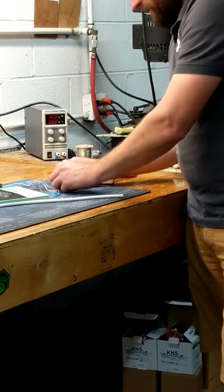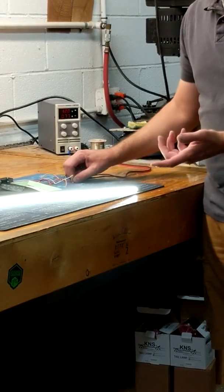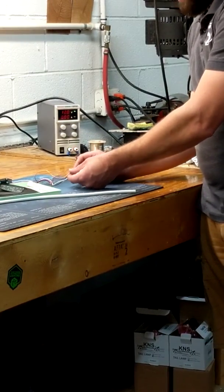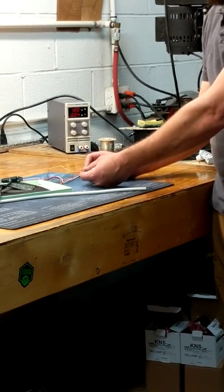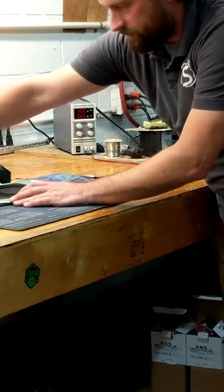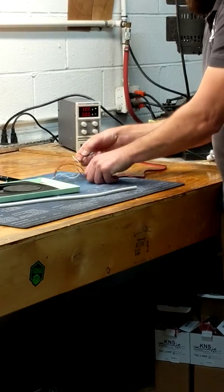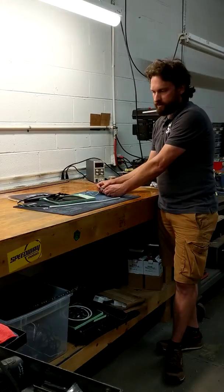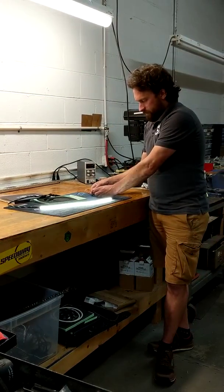The white wire you can turn on as a solid white light and leave it on as long as you want for a daytime running light. The amber wire — every time 12 volts is applied, it does one sequence across the strip, so it's specifically designed to be a turn signal. These won't sequence once and then stay on, so you can't use them as an amber parking light or running light. They won't stay lit on amber — they'll only stay lit on the white color.